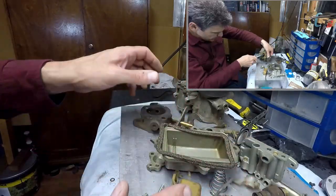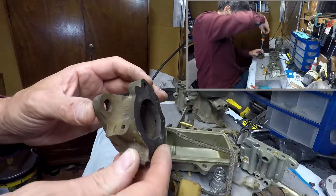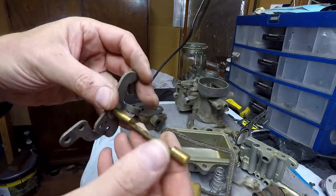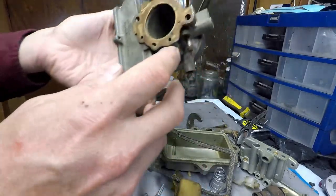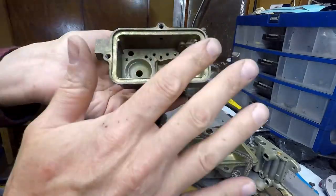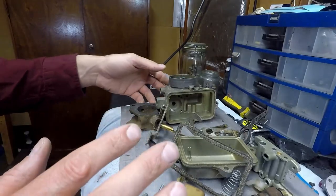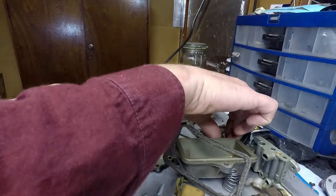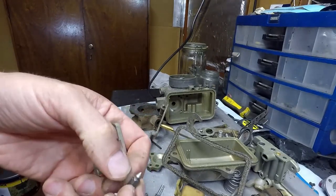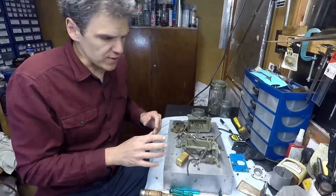It just needs a bit of ultrasonic cleaning and it should be fine. The base plate does have a bit of rust, but nothing that can't be cleaned up relatively quickly. Look at the throttle plate — the material here is really good. And look here, absolutely pristine condition except for a bit of dirt in one spot. I'm really pleased about this unit because it's in absolutely fabulous condition for a rebuild. The needle and seat assemblies — look at this — it's probably just about marked, but I could probably put it back and it will be absolutely fine. Things are looking good for this rebuild.